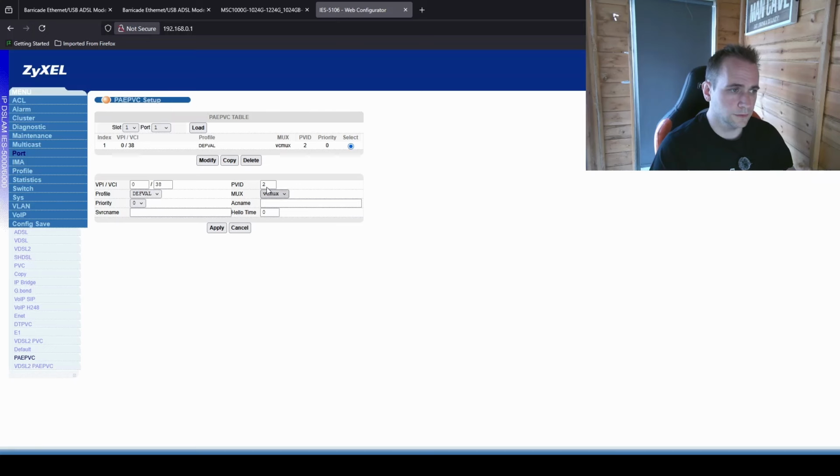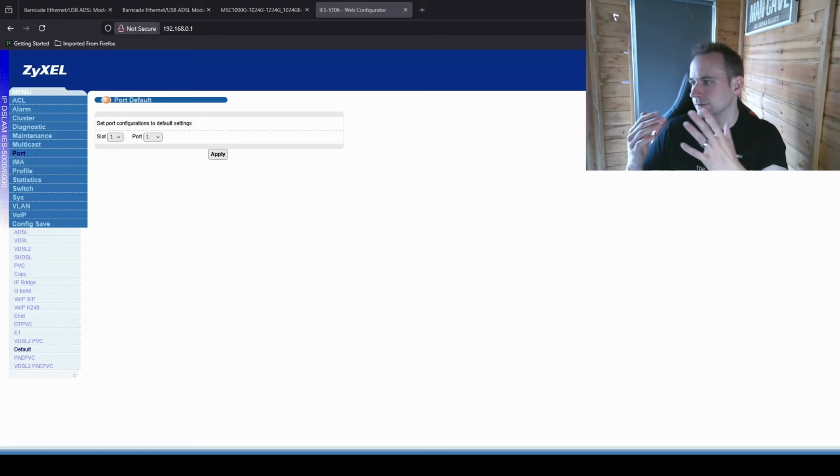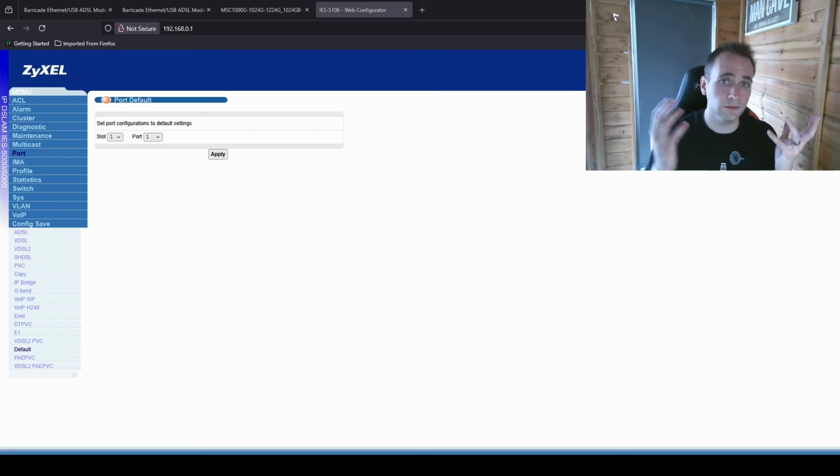And while that's rebooting, as I said, my concern is regarding this VLAN ID, but we'll see what happens. Okay, so unfortunately, the SMC is just constantly trying to sync at the second. Well, I say constantly trying to sync. It's not even flashing the sync light. So either something's happened to the SMC or it is the profiling on all of this that's causing the issue.